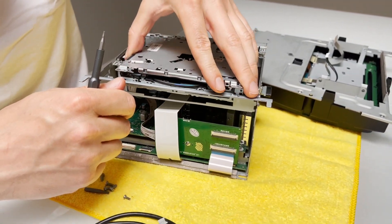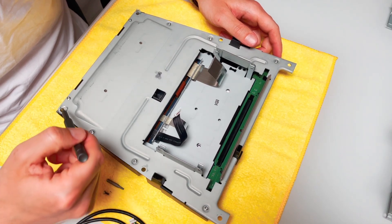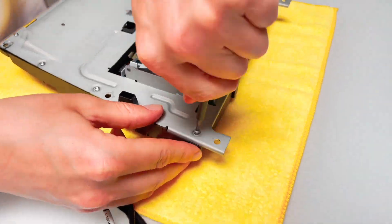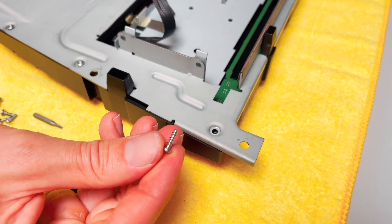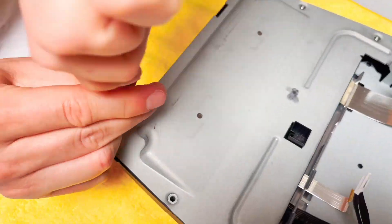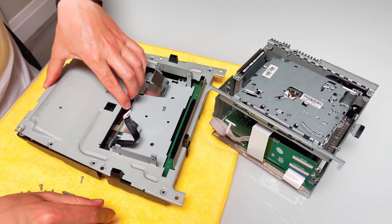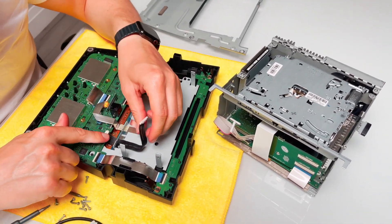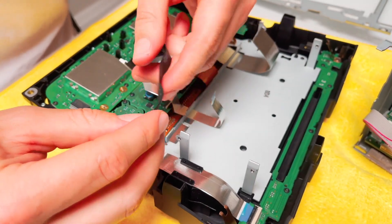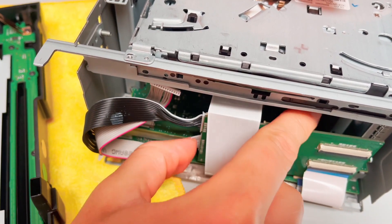This is the back of the LCD screen. Here you have eight bolts — four on each side — and we're going to use our T10 Torx to remove them all. As mentioned, these ones are different and almost look like wood screws, so make sure you're putting them back in the correct place. Now we're going to lift up this cover. We have to get to this cable — simply pull on it carefully and remove it. This cable will go to the extra motherboard we installed, so we're going to plug it in on top. It will only go in one way.